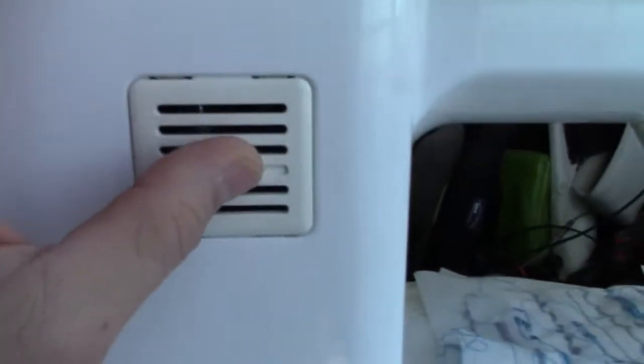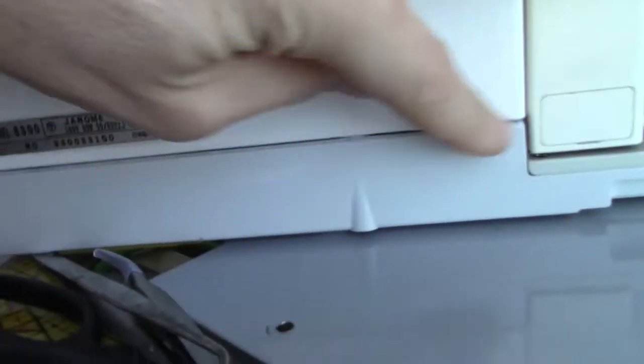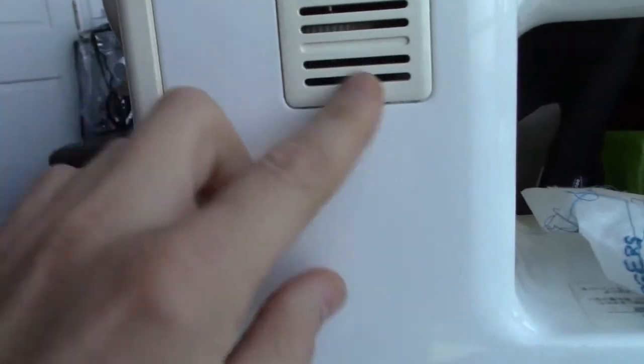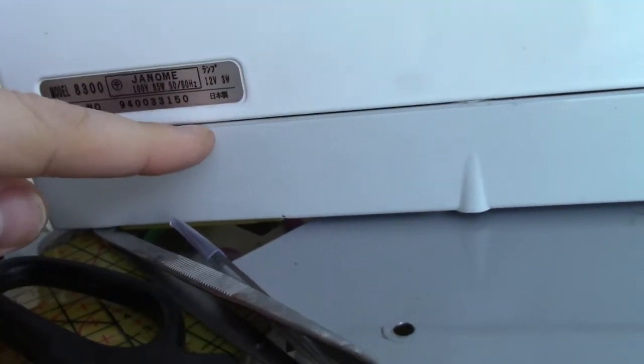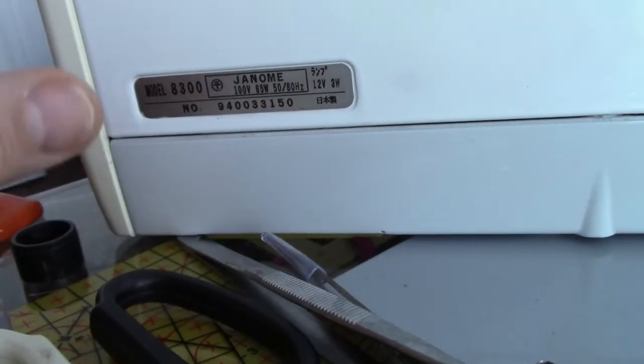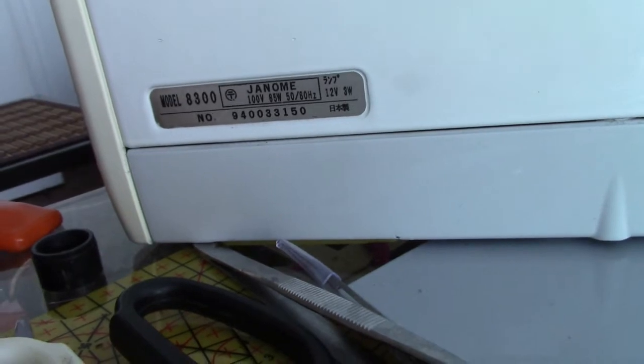Okay. The shaft runs from here down here. What I found out was that the carriage itself needed cleaning and lubricating. It was stuck, and that was what was causing the stepper motor error. It was trying to turn all this and it was stuck. So, four screws on the bottom, very simple, and then the bottom separates from the top.